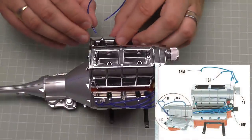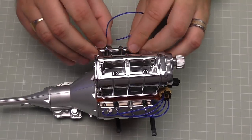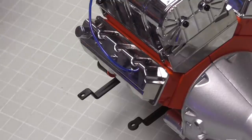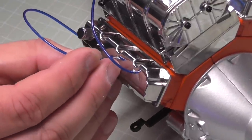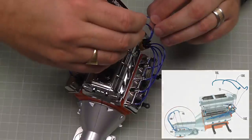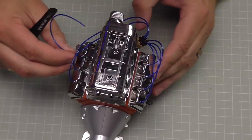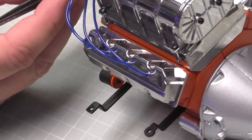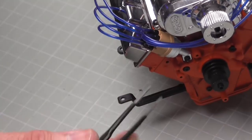We want to take the longest wire, which is going to go on this side, then all the way around to the next pin along. Then we work our way down — this time it's a 14 centimetre lead, following the same clockwise order. Then the next longest, and then finally the last lead, which means all the leads are in the distributor cap except for the one that goes down the centre. That firing order is completely wrong — you're not going to have an engine firing on one side of the cylinders and then the other. I've put a little diagram on screen of a V8 Dodge engine and that's what I'm going to follow, so I'll do that after I finish the last two stages.